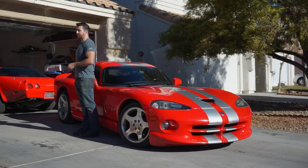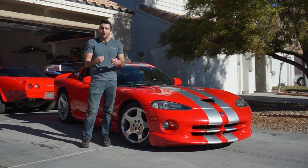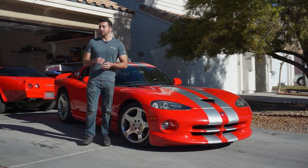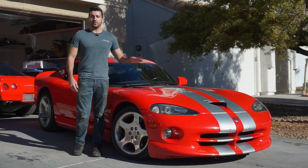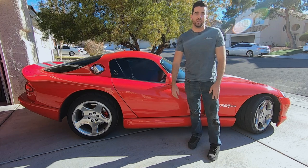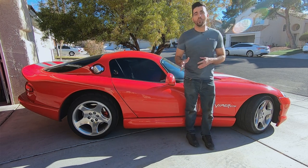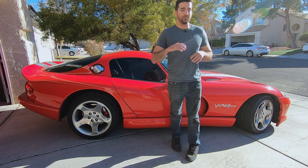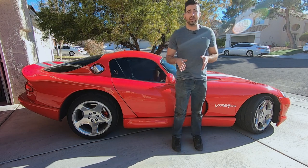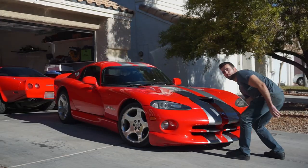Well, I never got around to it. So now water got inside the connections, and there's rust and things, and the wires are all hard now. Some of the insulation has come off because I didn't put wire looms or any of that stuff in there. So that caused one of the two fans to stop working, and now it overheats when it's like 50 degrees outside, which is ridiculous. So today I'm gonna go under the hood and fix all that wiring junk that I did and make it not only look good, but put the proper waterproof stuff in there so this won't happen again and it'll be very reliable. Let's run under the hood. I'll show you exactly what I'm talking about.